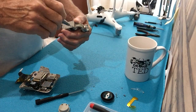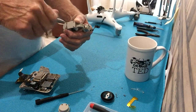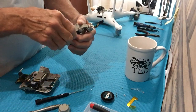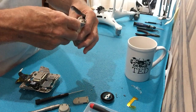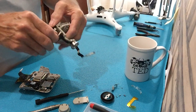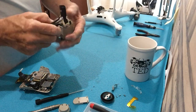The blue holds the cable in place. I'm going to go through this as quickly as I can so we can get to the yaw motor — and quick for me is not real quick; I'm quite old and have arthritic fingers. It popped right off. This protects the cover that covers up the ribbon cable. You lift the tab on this one carefully — I use a pair of tweezers and just kind of pop it out of there.